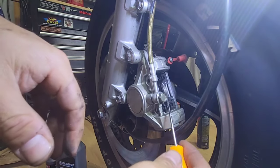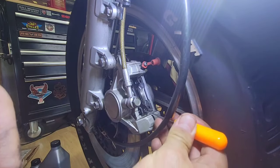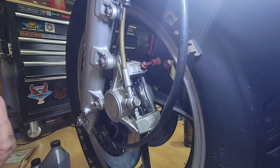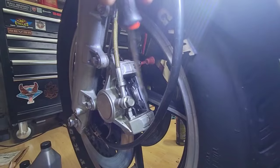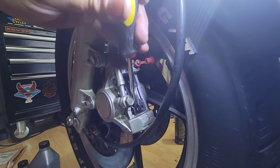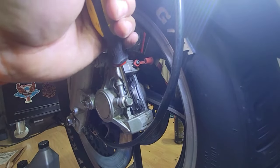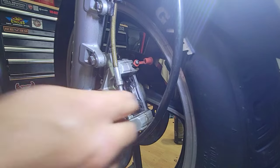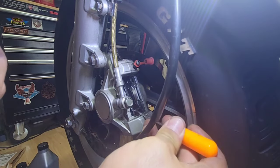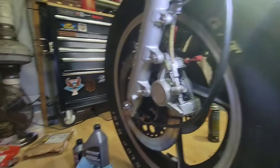These brakes are not working yet because I think the old owner was doing some kind of fix and he didn't finish. So what I will do is use a little bit of a pry bar just to push the thing. We want to move the cylinders to compress them so we can pull the brake pad. It's still a bit tight. I will try to find a leverage point, but I need to move the camera.